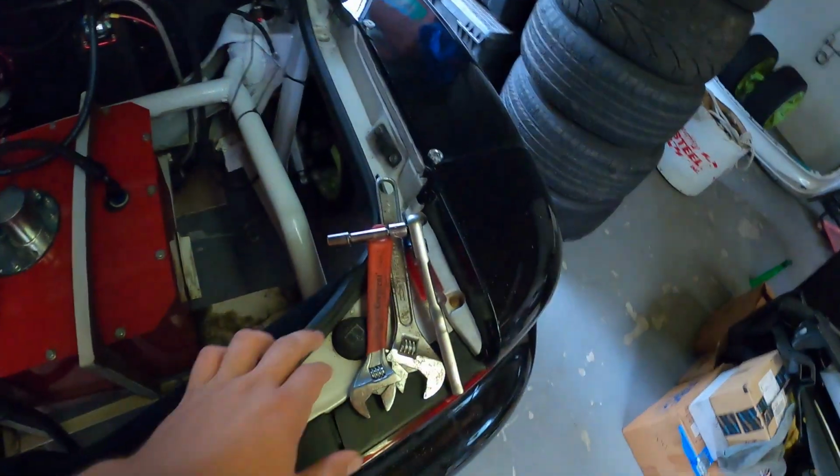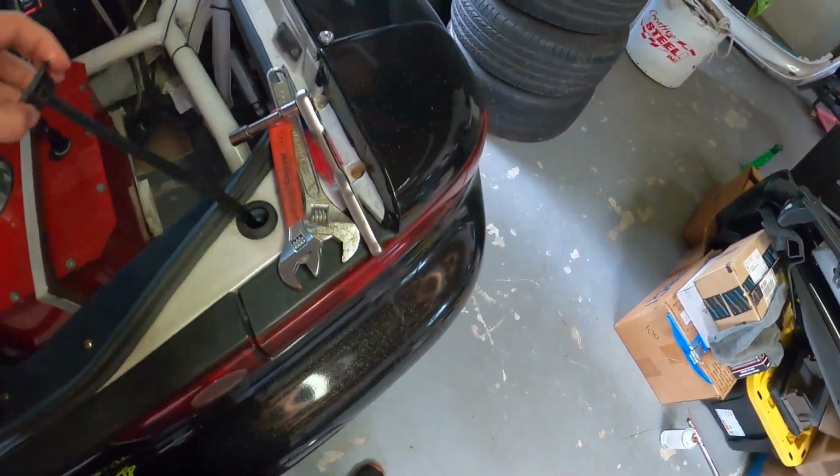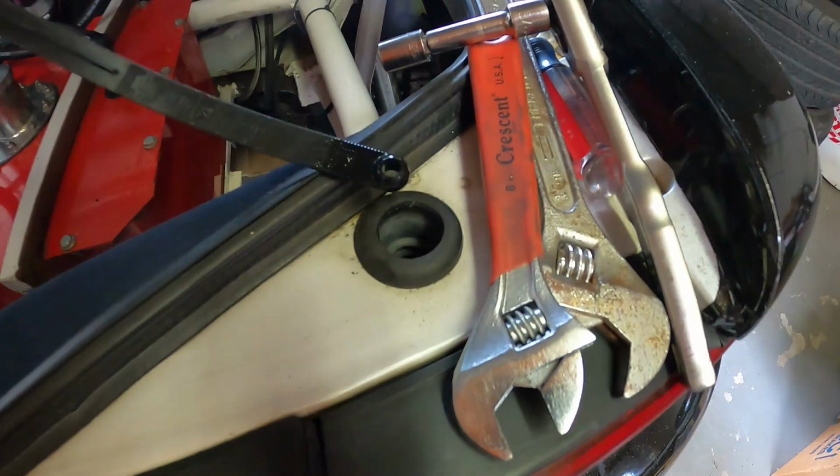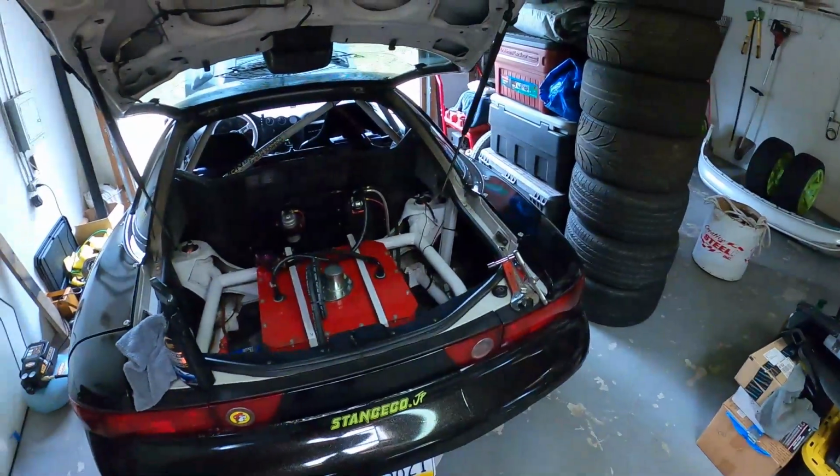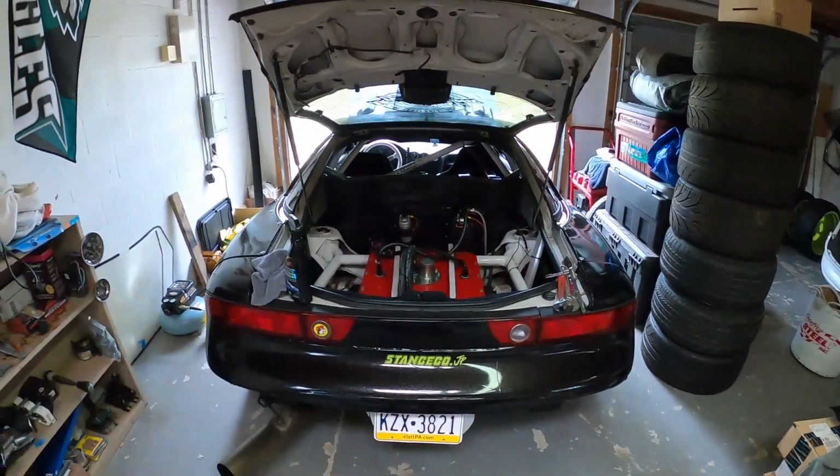I have the tire sprayers, and I'm gonna try and make sure that I use them in between runs at this track, because obviously it's gonna be hot. It's gonna be like 92 degrees ambient. Track temps are probably gonna be well over like 130, 140 degrees. So I'm gonna bring plenty of jugs of water. I actually have 2 gallons that are filled with just sink water, and keep this guy topped off so that I can continue to use my water sprayers. Oh yeah, look at that, we're low, we're only at a quarter tank. But I can continue to use my water sprayers to help maximize my tire life and get the most out of them. So I'm gonna get started on the coolant and start getting that water put in here.